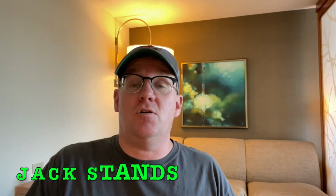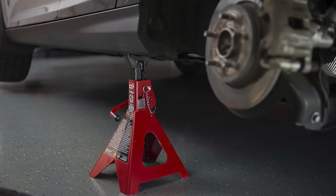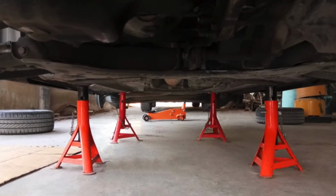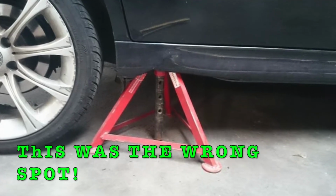We just lifted your vehicle up using that jack, not destroying those pinch welds, using that diagram in your owner's manual where to lift it up at. Now we need to put that vehicle back down on some jack stands so you can work on it, take those wheels off, etc. Using that same owner's manual, you're going to put that jack stand underneath the right points. Additionally, you have pinch welds still, you want to protect those.